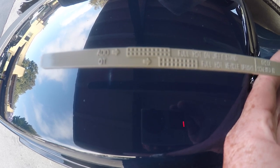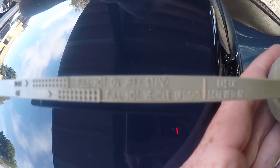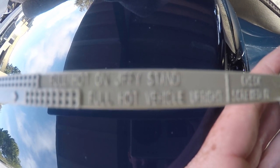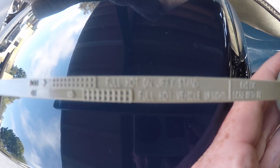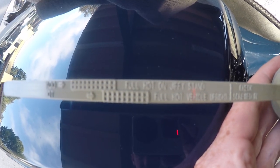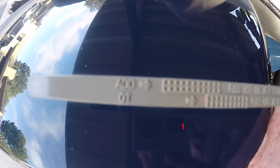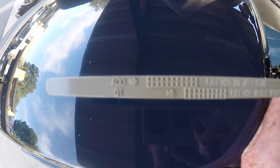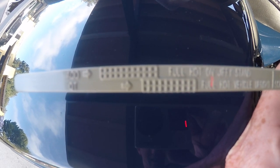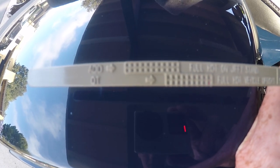I'm going to show you how to check your oil. You want to be in the dotted lines on the dipstick when the oil is in there, the bike is hot, and it has been running. It says check screwed in and check hot. One mark says full vehicle upright — that's if you have a wheel chock. One says full on jiffy stand — that's when you're on the kickstand. Run it for a bit to get the oil circulated all through the motor, because there are a lot of places for oil to go in these M8s. Do not measure it right away — this oil has got to go everywhere, including the radiators, oil filter, and heads. If you check it right away, you're probably going to think you're overfilled. Trust me, you're not.